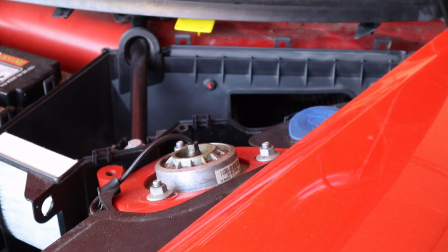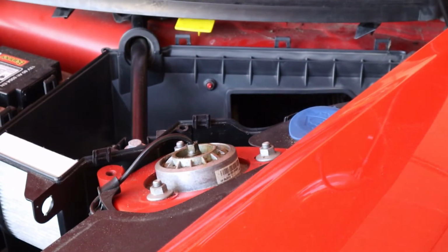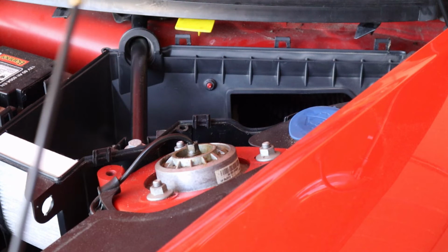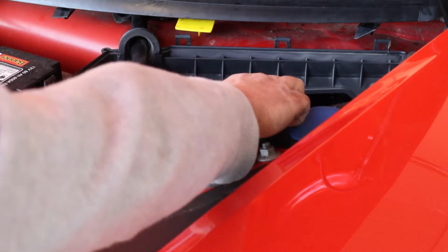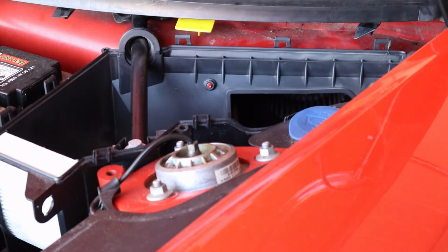Open up the front lid, take off the plastic cover. This piece unclips, which is the area for the pollen filter. Get a stick or a rod or something, don't put your fingers in there. And spin the fan in there, and that'll free it up. And then just make sure to use the fan on full every now and again, and you should be fine.